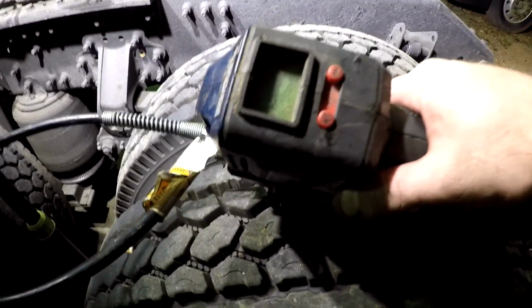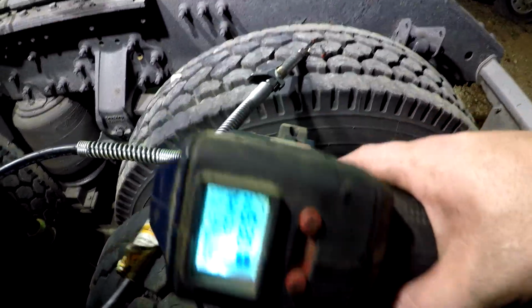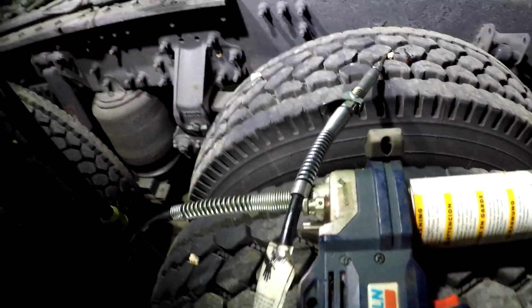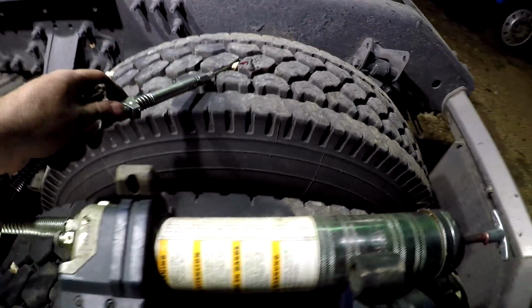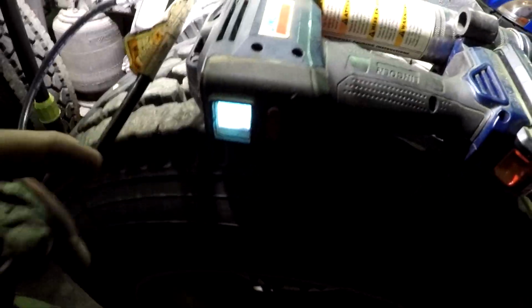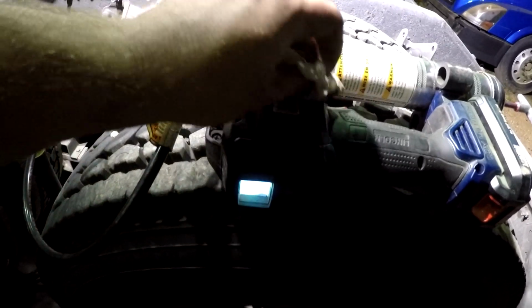I don't remember, but this is a grease gun. I'll put a link in some of this stuff if I can find it again. We used 8.5 ounces of grease, and we'll put a tube on the fifth wheel when we get done. We latch it back up to the trailer, and that should be enough grease to grease the trailer as well. So about 1 tube of grease, grease the whole thing.